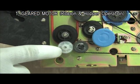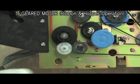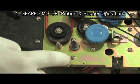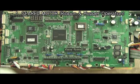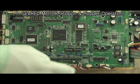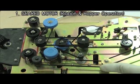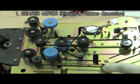Remove pulley and gear after removing each E-ring circlip. Replace motor after removing 3 screws. This is the geared motor connector. When you put the belt on pulley, please do it as you see here.